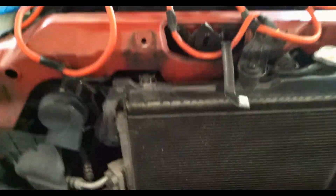The solution that we have used for the cleaning of the condenser is a mixture of one pack of dishwashing liquid and one tablespoon of baking soda, and the rest is just tap water.